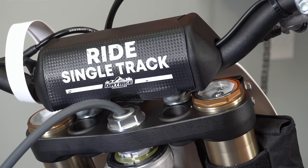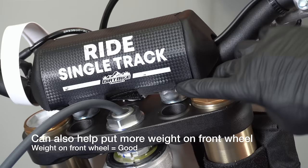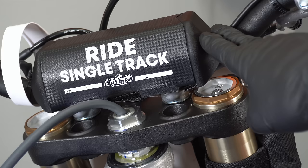Many bikes have different positions that you can mount your handlebars in. This one came closer back towards the rider and I moved them forward to give me a little bit more room. A lot of bikes will even have ways you can turn around these handlebar mounts to fine-tune that in, giving you three, four, five, or six different handlebar positions.